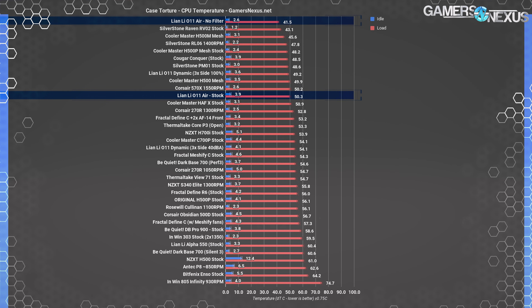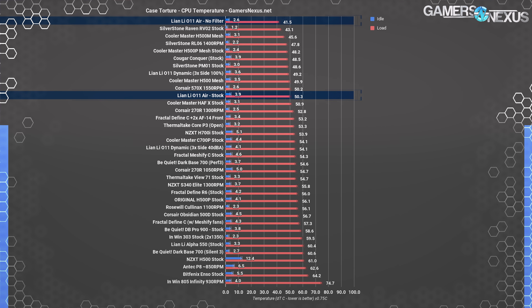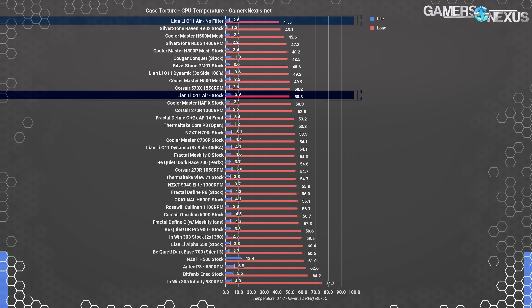Comparatively for CPU thermals, performance is impressive when the filter is removed — only then. Removing the filter's huge impedance brings us to 41.5 degrees Celsius over ambient, superior even to the long-standing leader, the Silverstone Raven RV02. Unfortunately, because this performance isn't achieved with stock settings, we can't give the O11 Air our best-of-bench award — Silverstone retains that. The leading performance is derived from close proximity between the CPU fan and the intake fan, good exhaust avenues, and good intake positioning. Performance is exceptionally competitive once the filter is removed.